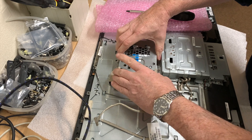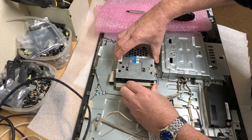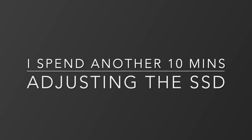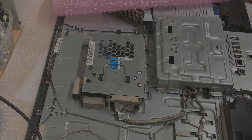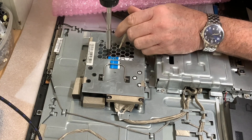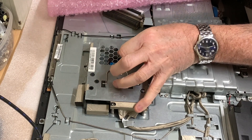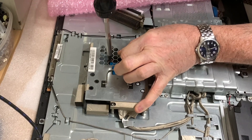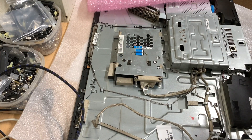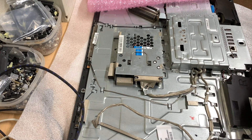We're going to fit a Crucial 2.5-inch 1TB SSD hard drive. Let's try and get this fitted and see if we can get it at the right height. Not quite — it needs to come over a little bit. I think I've got it in the right spot now, it's a little bit of jiggery pokery. So I'll undo this a bit, make sure that the SSD is definitely well pushed forward, and now we'll tighten the screw. That should now be fitted in there. We can add a little bit of hot wax through the hole here just to give it extra grip, but the SSD feels like it's in.